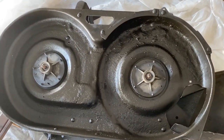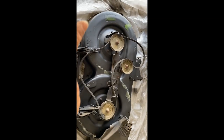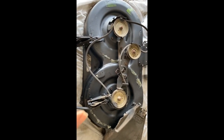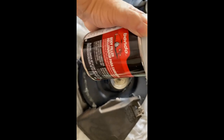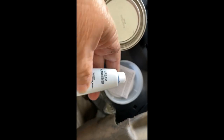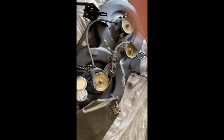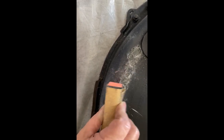I'm going to flip it over and do the same thing on the top. I'm going to rough up those areas where the fiberglass is showing — just enough to rough it up, not to sand it to death. Then I'm going to use this Bondo body filler. It comes with a little dish and a cream hardener. First you rough up that area — this is 100-grit sandpaper, the only grit I had at the house right now.